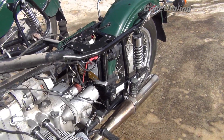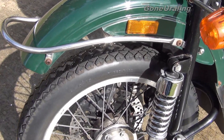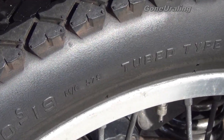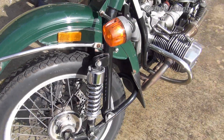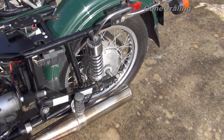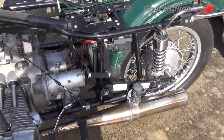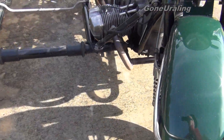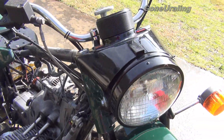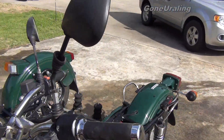It is going to need new tires, even though they've got decent tread on them. I don't know if you can see it in the video, but these tires have been sitting a while — there's a lot of spider cracking, little spider vein cracks all over the place on all three tires. I'd be fine test driving at 35–40 mph, no problem, but I certainly wouldn't want to get out on the highway and heat these tires up to find out one of them is ready to go.